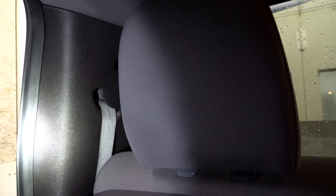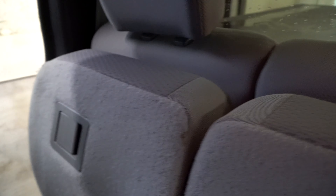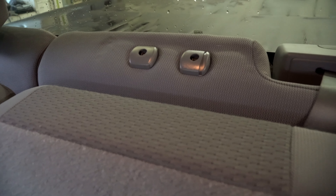So if you have a little cordless Milwaukee ratchet with a short 9 millimeter socket, that's perfect. You will be able to slip in behind this headliner here. So anyway, we'll get started. You've got to take the seat off, side trim, and then behind the seat there is an insulator pad that you'll need to remove, so you can access the 9 millimeter nuts all along the glass.